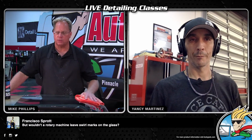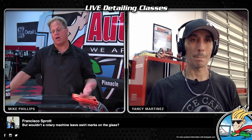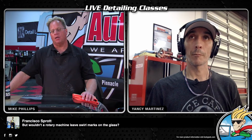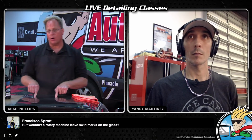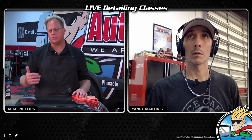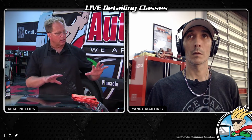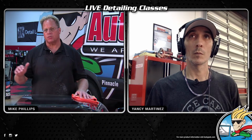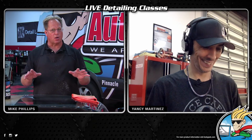Would a rotary machine leave swirls on the glass? Well, no, there's no swirls here. It just depends on the abrasive technology you're using, but glass is harder than paint. I've never seen it myself. And here's one of the things I teach whenever I write an article, whenever I make a video, whenever I teach a class, or whenever I do this for someone else: whenever you're polishing glass, in case you're in doubt of anything that you're doing or using, never start on the driver's side of the windshield in case something goes wrong.